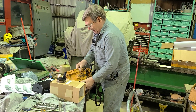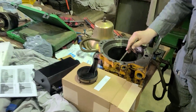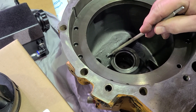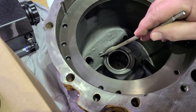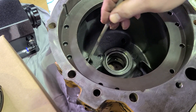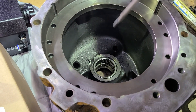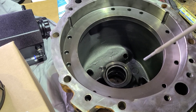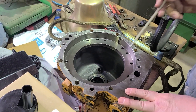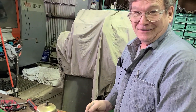If you had one that was totally destroyed — just too far gone, or you didn't have a shop that could sleeve it — it would be possible to plug this, drill it, tap it, and make it work without that shuttle altogether. Totally modify it. When working with that shuttle, you also have to be aware of things like this plug right here. That plug is in there to plug this hole, which we also have to open up these casting holes after we put the bushing in — these are for lubrication feedback most likely. If we use the original valve, we don't have to guess how much oil comes back for lubrication.